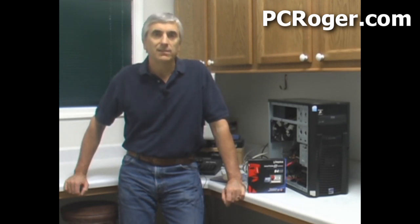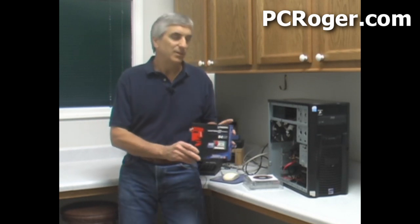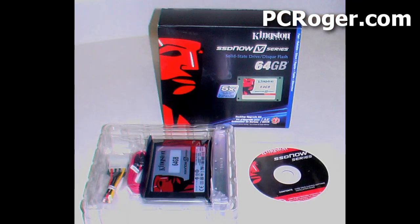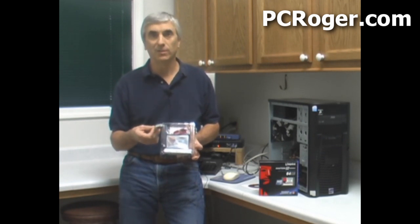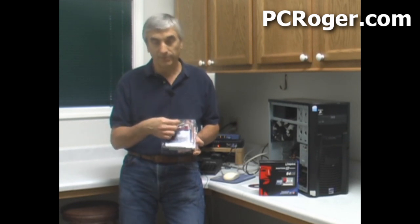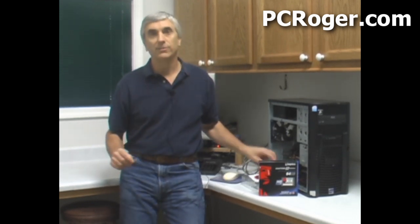What we've got here is a Kingston SSD Now drive, and this is an upgrade kit that costs just a couple dollars more. In addition to the drive itself — which is the same size as a 2.5-inch serial ATA laptop drive — you also get a little power adapter if your power supply doesn't have the newer connector, a data cable, and drive brackets to help this 2.5-inch drive fit into the 3.5-inch drive slot in your desktop PC. We also get software that will clone the old hard drive to the new drive, making it pretty trouble-free.